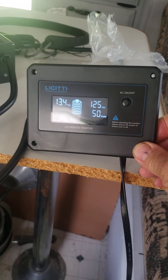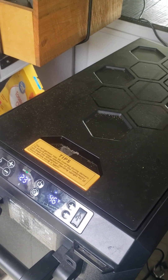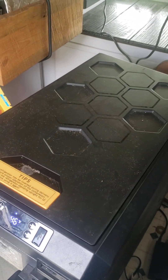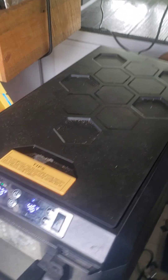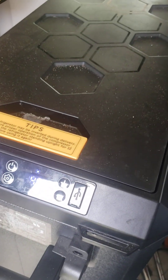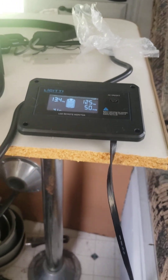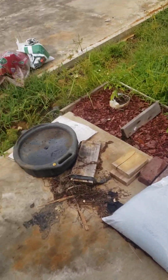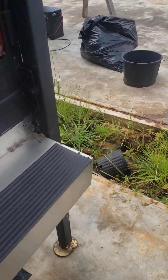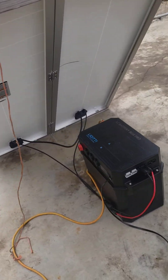One side's down to 23 and I just had the top open so the other side's up to 46, but it's cooling down — that's the reason it's drawing the wattage. When it cools down to about 35 degrees, the compressor shuts off and the 50 watts will go to zero. Step outside and look at the setup a minute.